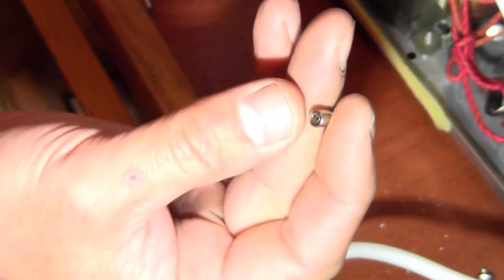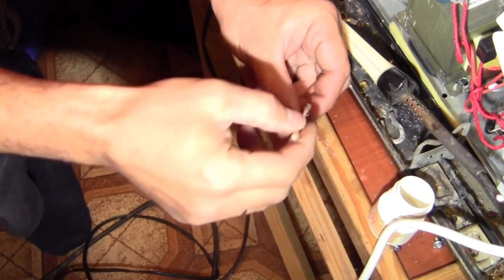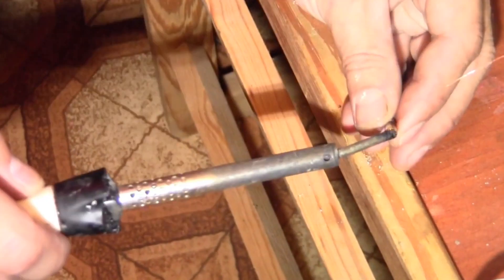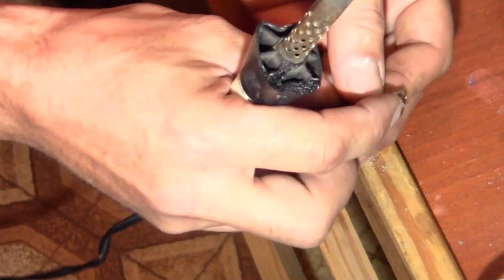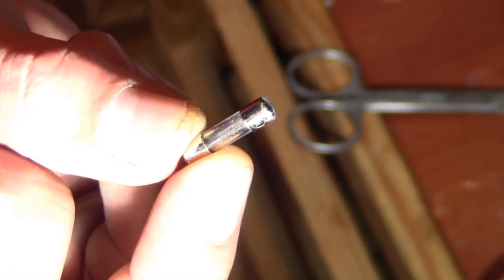The holes have been drilled on both sides. We very carefully solder the wire here, lightly and thoroughly coating the sides with soldering flux — this step is very important. We carefully insert the new wire inside, then bend it from both sides to ensure it is taut, and solder it well. The fuse is now soldered on both sides. It is now not 1.5 but 8 amperes.